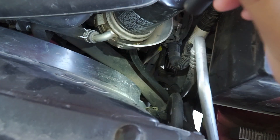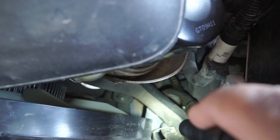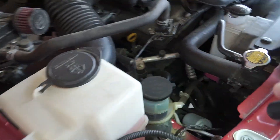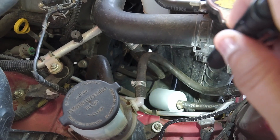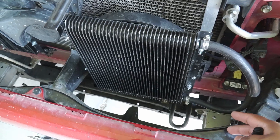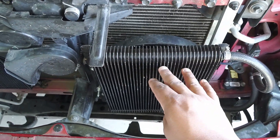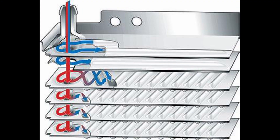Another cool little thing that I did that doesn't come from the factory is I added an oil filter. This oil filter — you can kind of see it's that shiny silver thing way down there. It doesn't come like that from the factory. Very few vehicles actually come with an oil filter for the transmission. It looks similar to this filter here which is for my power steering — that'll be on a separate video. I put this filter on the inlet, before it comes to the cooler. The reason behind it is if I can keep the cooler clean by putting the filter before it enters the cooler, the cooler can operate at its best because I wouldn't have accumulations inside the little grooves where the oil twists and turns.